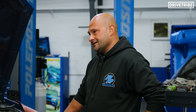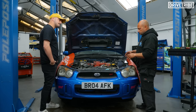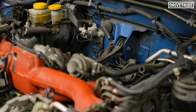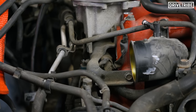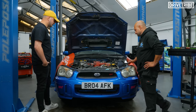So what's the process of getting this engine out? We want big power so we need to get it out. The process is: remove everything from around the engine, remove the radiator, disconnect the water system, disconnect the electrical system, the fuel system, and then once we can see and get the engine unbolted from the gearbox, we'll lift it out and into the engine room.